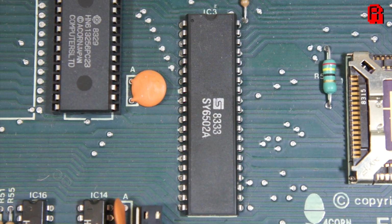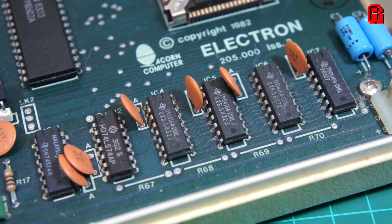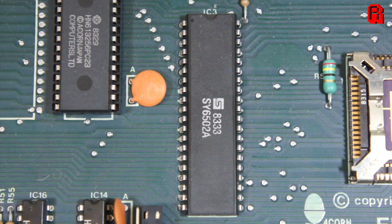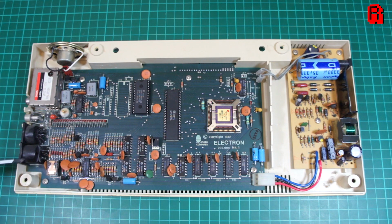A modification was later discovered which allowed you to exclude the ULA from accessing the first 8 kilobytes of memory. This allowed the CPU to access that portion of memory at the full 2 MHz, and so by applying the hack and storing variables in that space, programs could be sped up significantly. Some think if this small modification had been made to the original machine, it would have had a greater impact on the market.